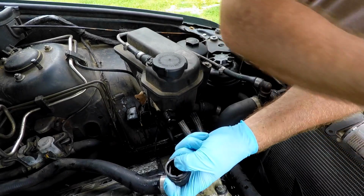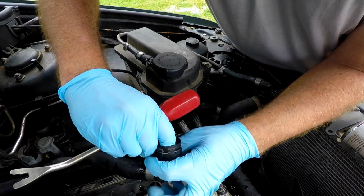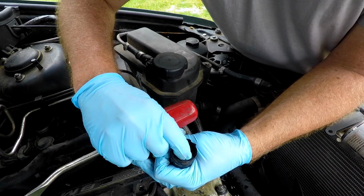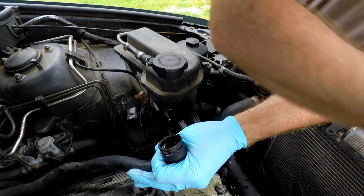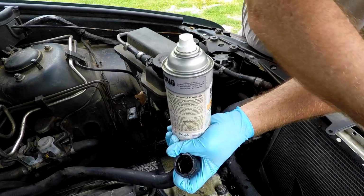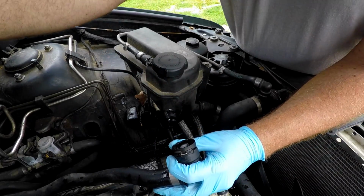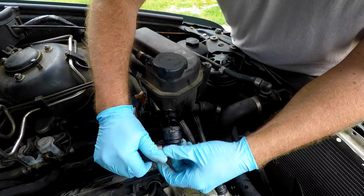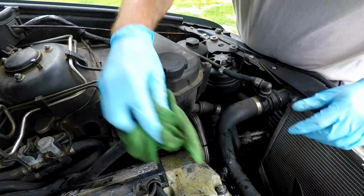Tell you what, we're gonna push the one side down the groove, and we're gonna fumble a whole bunch because we're on camera. Oh, not too bad. And there it is. Now, before you could just push it back on, since it is a new ring, we're gonna take a little lithium grease, give her a little drinky drink down there, and with our clip back closed, we're gonna go up here, line the hole up, and bam, there it is.